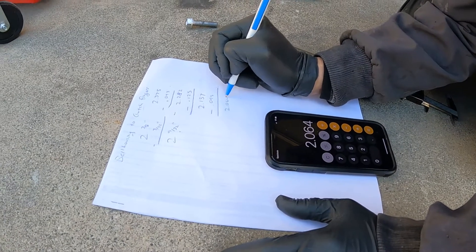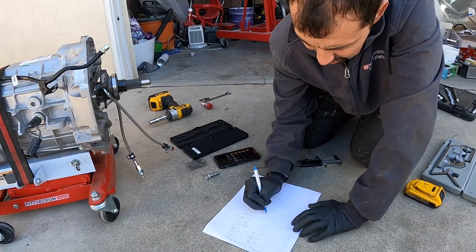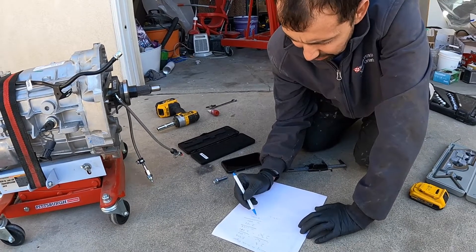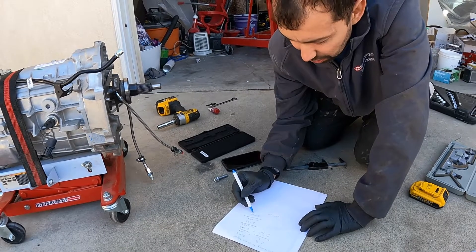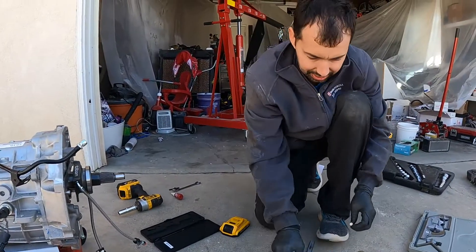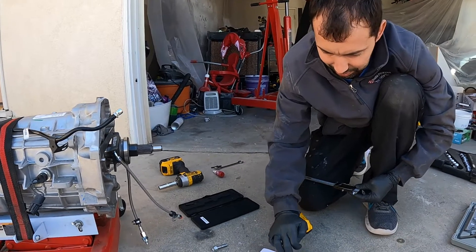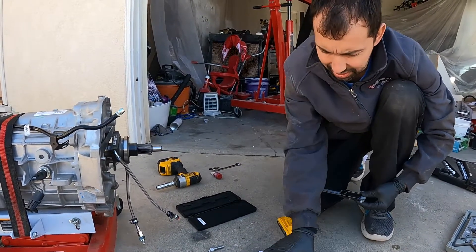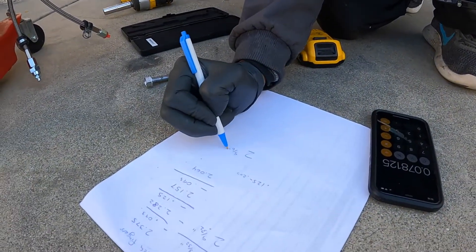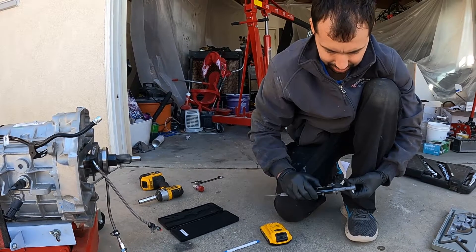According to Tilton the air gap can range from 0.125 to 0.200, so being a little over is fine. I can land anywhere in that range. I need about two and a sixteenth, but let's see what 5/64 is — that's 0.078 — so I'll be slightly over the 0.125 minimum. I want to see two and 5/64ths on this measurement, so I might as well just set it up right now.